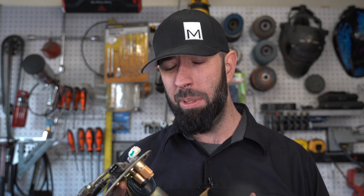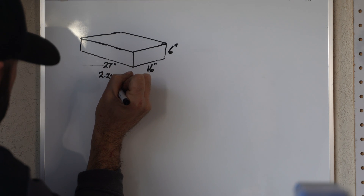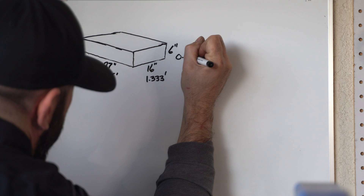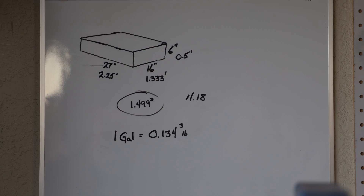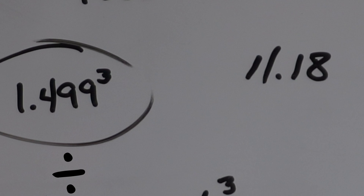That's going to create a couple of problems. Problem number one is fuel volume — how much gas would that tank even hold? That involves math, unfortunately. I hate math and I'll probably do it wrong, but here it goes. To find volume, we multiply length times width times height. Converting to feet, that gives me 1.499 cubic feet. A gallon of liquid takes up 0.134 cubic feet, so dividing gives us 11.18 gallons. 11 gallons isn't bad — who am I kidding? 11 gallons is terrible.